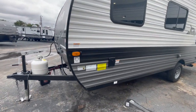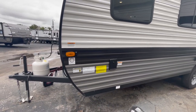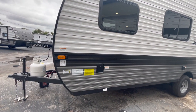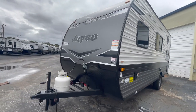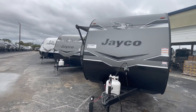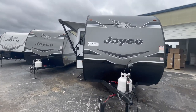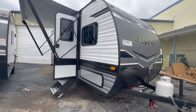This little unit sits at about 20 feet total length, and your dry weight is going to be 3,100 pounds — that is loaded with propane, no water. You don't really want to pull with a full load of water if you can help it. It's going to bring down that trailer. They're meant to be pulled with maybe a little bit of water on board, but not a full tank because it'll slosh around and kind of make a mess.